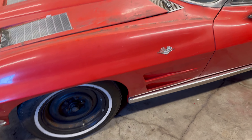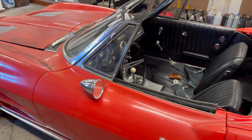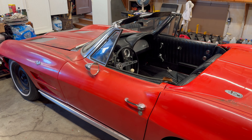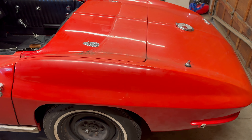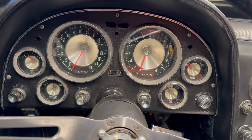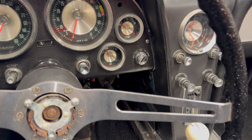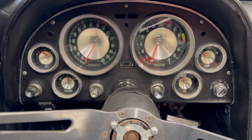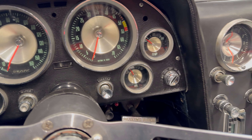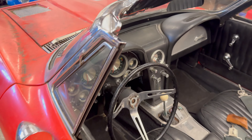All I wanted to do was get those unstuck, but my uncle came over and he had the compression tester. We tested it — seemed good, was like 130 to 150. And we already did the bore scope like a week ago, so we weren't too worried about it. That thing fired right up. Speedometer worked, tachometer worked, oil pressure gauge worked, fuel gauge worked. The battery gauge did not work. The temp I don't think was working either, and I don't think the clock is. But who knows — that was cool.